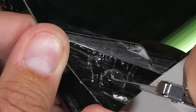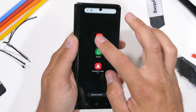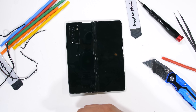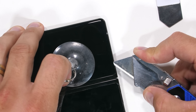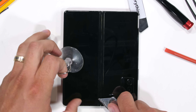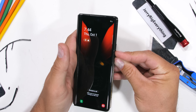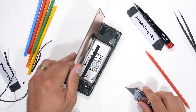As much fun as that was, I think it's time we turn off the phone and open it up like a normal person so we can get a better look at the internal hinge and those new bristles. First, the teardown skin's got to come off — link in the description. Then we can use the old heat gun and razor blade combo to remove the screen. Repair shops usually have large hot plates and suction machines to do this a bit safer and more efficiently, so if your phone ever does break, don't think every repair guy is running around with a hair dryer. Once the adhesive is cut around the outside, I'll just turn it on real quick to make sure I didn't break anything. Looks great. Once it's off again, I can pop out the rubber stopper over the screen ribbon and remove the screen.